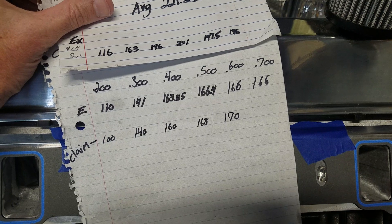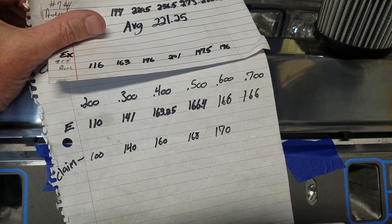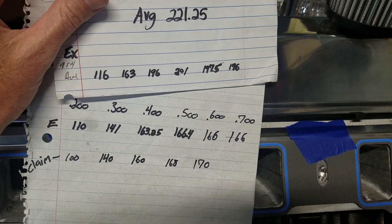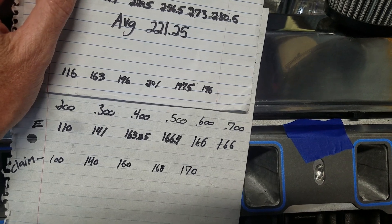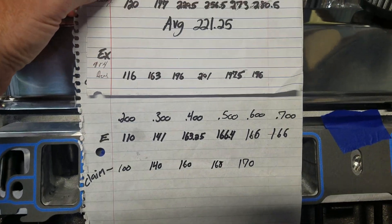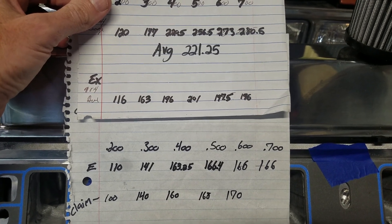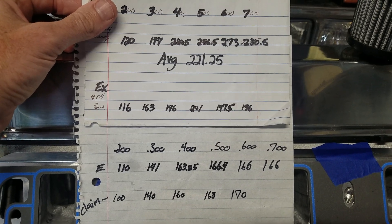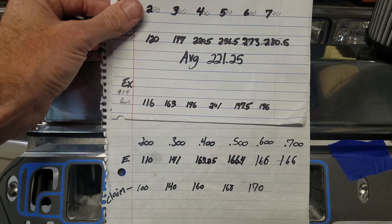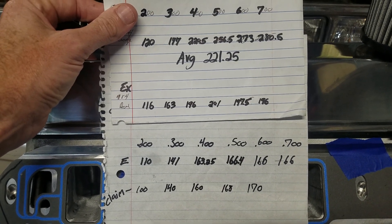That was pretty much the top point before — it did 166 at 700 thousandths also. Now we're at 197-196, so it pretty much just tops out around 500 thousandths, but instead of 166 it sits right around 200 CFM. That's a very large improvement. I know this head has more left in it, but it's reached the point where as far as budget goes you'd have to start spending money — more time on the flow bench, or switching to different style valves — to get more airflow out of it. For the average guy who doesn't have a flow bench and isn't going to spend more money, you should be able to achieve these kind of numbers, which is pretty solid.